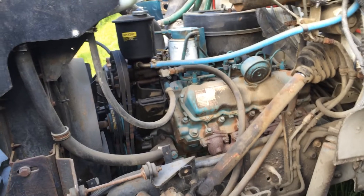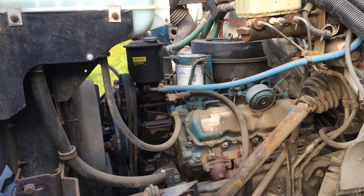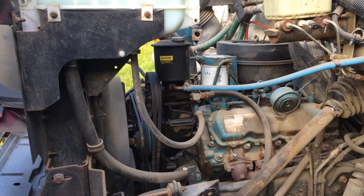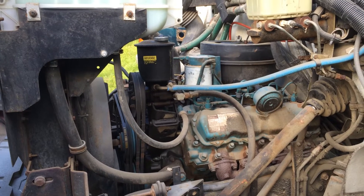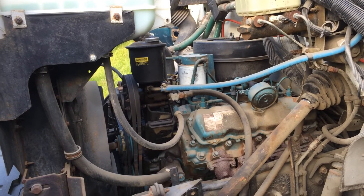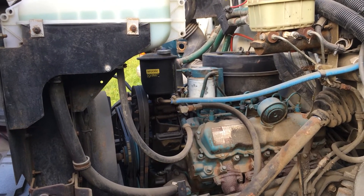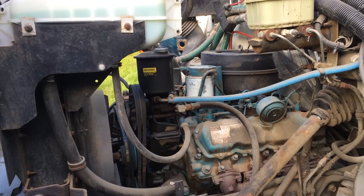I'm wondering if turning up the fuel pump can give me that extra little boost of energy. I don't want to wear the engine out. Do I need to turn up the fuel pump or remove the governor? If the engine isn't reaching 3000 RPM on the highway, then the governor isn't causing a problem on the highway because we haven't even hit it yet — unless it's one of those governors that limits the amount of fuel rather than actual engine speed, but that doesn't seem like the case since it's a pretty flat 3000 RPM governor.